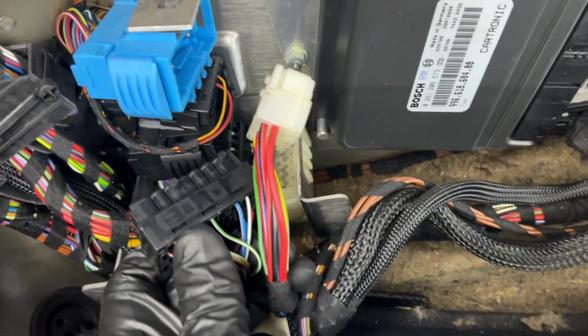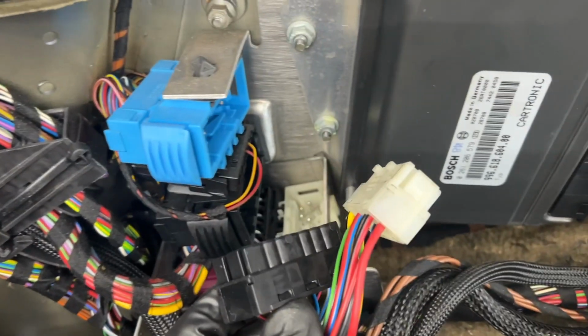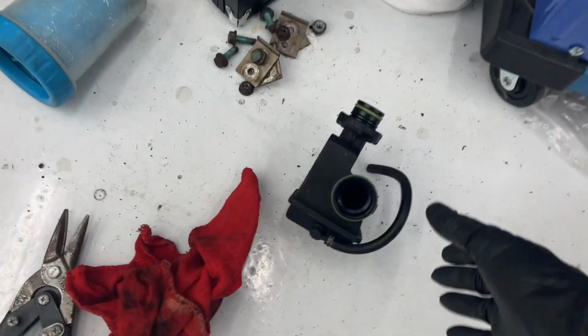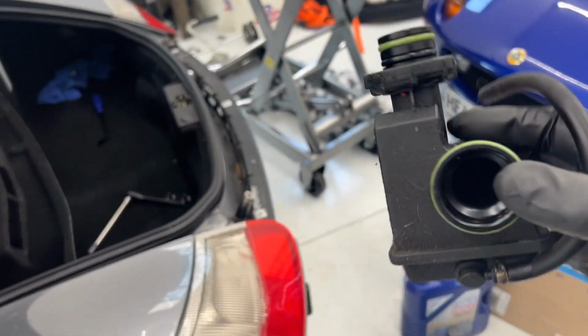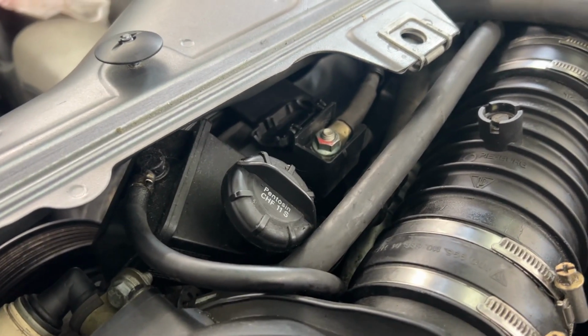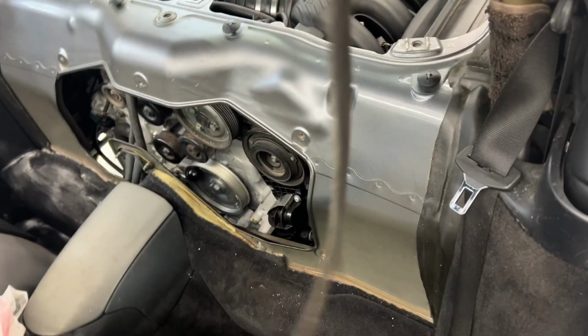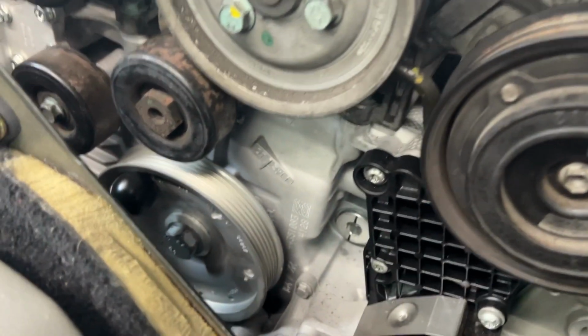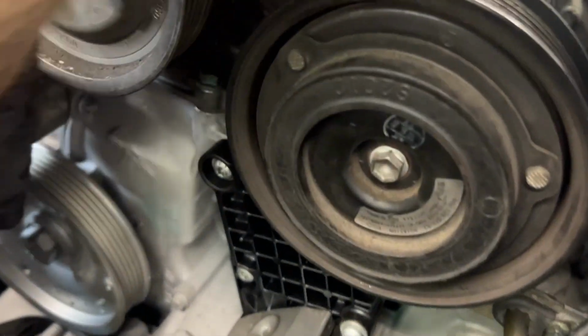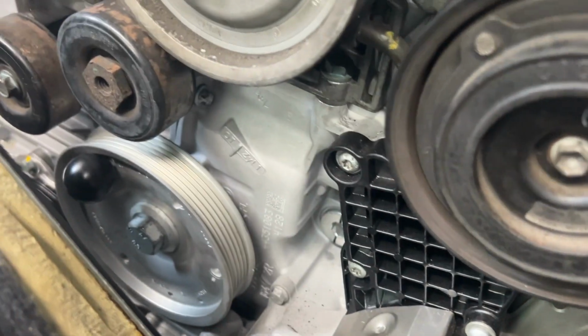All right, 3 more connectors down here. Blue, white, black. They're color coded for you. Looking around the garage, one more important thing still, our power steering reservoir. We should probably install that. Power steering back in. It would be a shame to forget to install the belt as well as pulling out the pin for keeping us at top dead center. So let's do both of those.